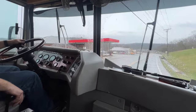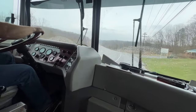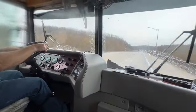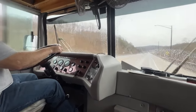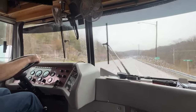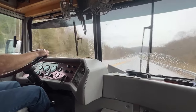Over on this shoulder here safely if you can, and I want to get out and look for a rock in the tire. Okay, no more tick tick tick tick tick tick. Yeah, that's great. Only because we just repacked the wheel bearings, it could have been something else. Right, I get it. Make sure. A loose wheel will make a ticking sound like that too. Okay. Crap between the rim and the brake drum can make a noise.